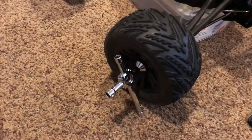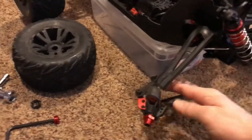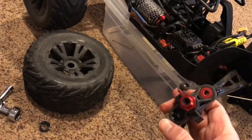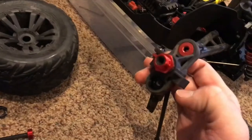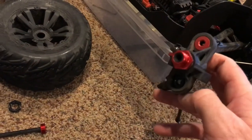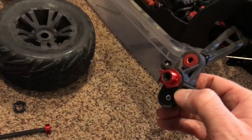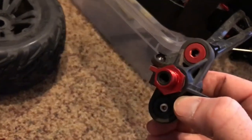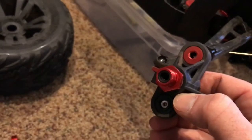I'm going to take the wheel off and then bounce right back. Now that I've gotten the wheel off, I also removed what looks like some aluminum plugs — freaking anodized aluminum plugs. I just took that plug off so that I can access the end of that sucker. And sure enough, there's that Allen head. I'm going to go ahead and loosen that Allen head up and then try to remove it from the other side.